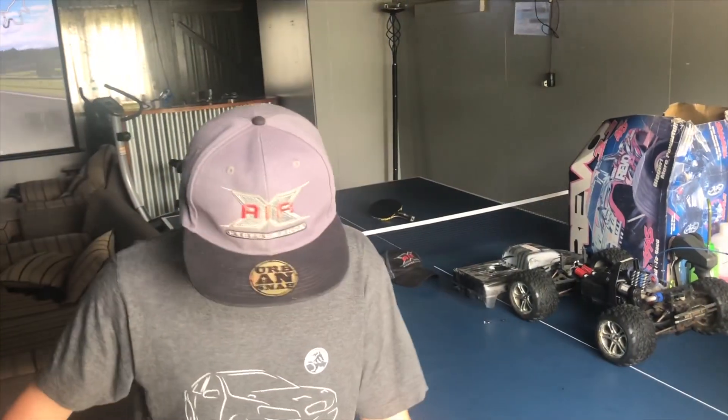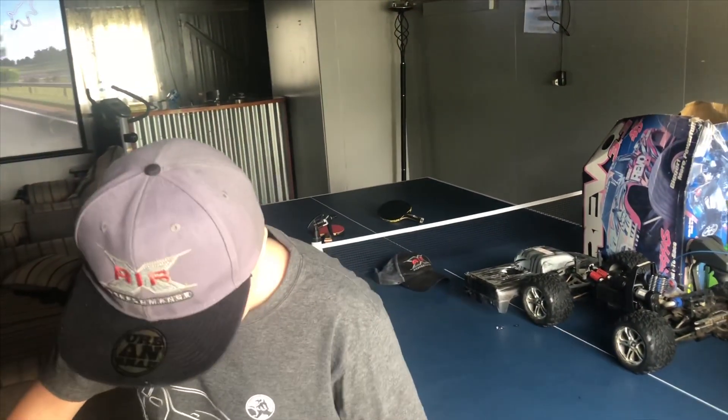What about the boot — what did we do there? We put a little stubby spoiler on it. We used a Series 2 lip spoiler, but we had to weld up the holes left by the bigger factory spoiler, and then painted all that.